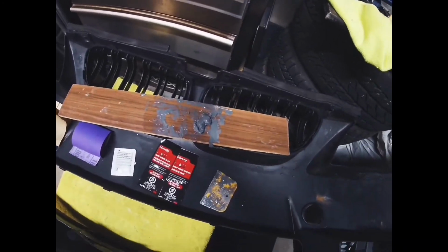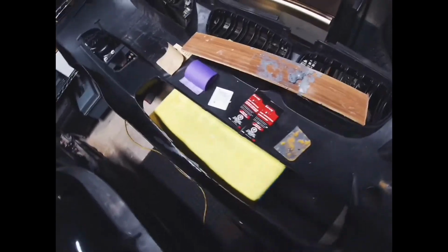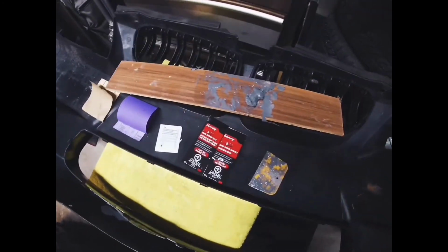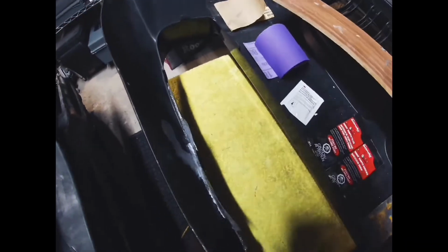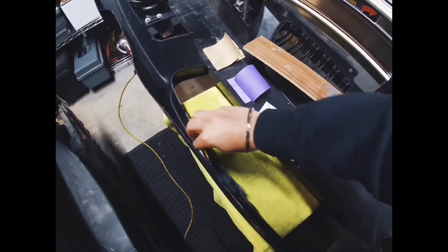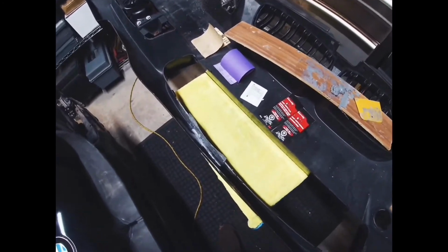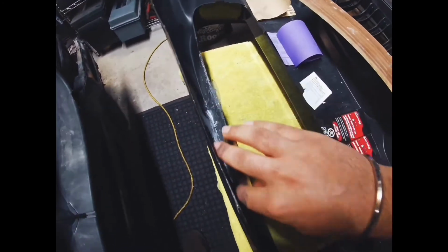So before you start emptying these out, make sure you're ready to actually use it on the surface you're trying to fix. Once you've done that, the kit does come with these little mesh pieces, quite a bit of it. The advantage is that the mesh helps strengthen the area that you're working in. So what you can do is take just a little bit and spread it along in a very thin layer to begin. You have to work in thin layers because you don't want any pinholes and air going in. So spread a very thin layer across the crack.